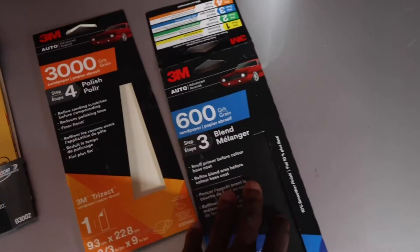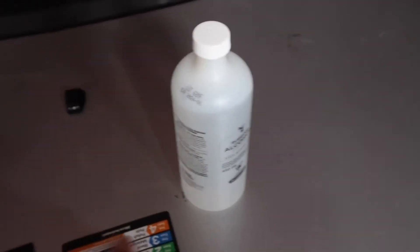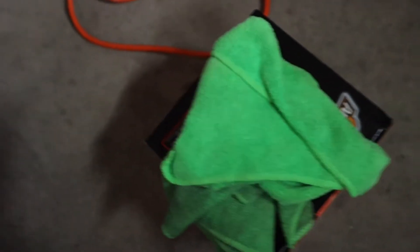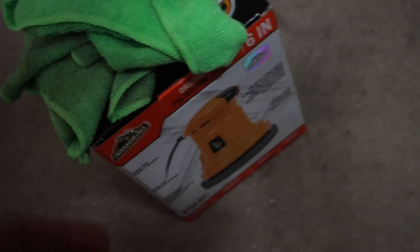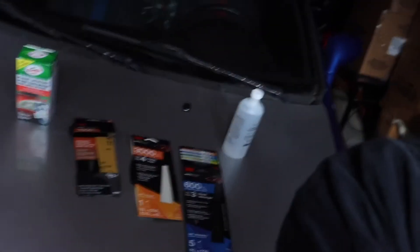Get your 600 grit — you can get 400 or 600 or 1000 if you want. I went 600, 1500, and topped it off with 3000 grit. Alcohol helps speed up the drying process. Get yourself some microfiber towels — every car enthusiast should have those. For a buffer, you don't necessarily need it — you can do it by hand — but a buffer makes it a whole lot faster. And an extension cord if you need one. That's pretty much all you need to get this job done.